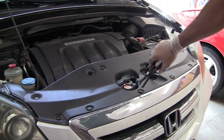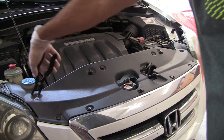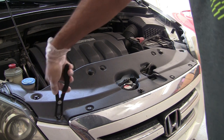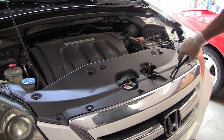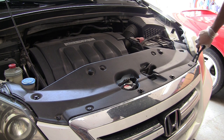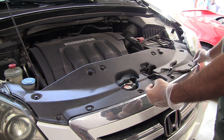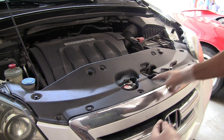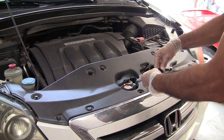I'm going to use these tools to pull these trim clips out. That one's already loose. You kind of pull them out this way. Some of them I might need to replace — I've already taken this apart before and some of them don't want to come out, but I do have some extras. The ones in the front are a little bit longer than the ones on the side, so you have to be mindful of that as you're pulling the stuff out.